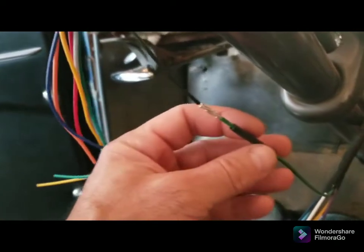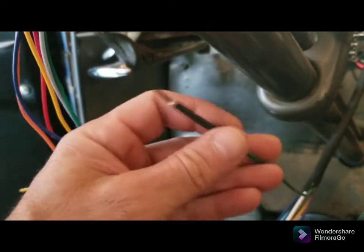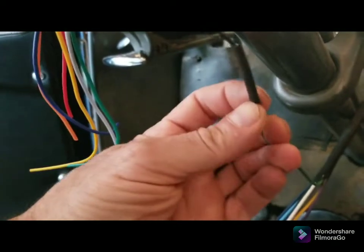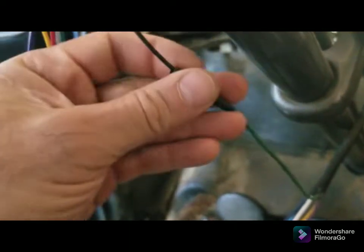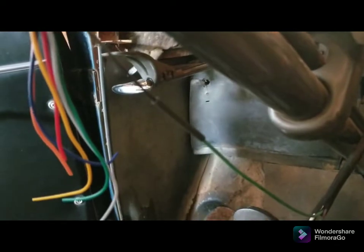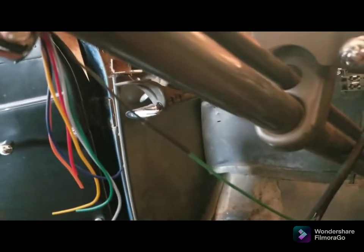So that's how these non-insulated connectors look before you shrink tube them. I like them so much better than the insulated ones because those use cheap plastic. Now they make some that have heat shrink tubing attached to them, but I don't like that either. I don't want to crimp all my heat shrink tubing. So you slide the tubing up there and bow, there you have it.